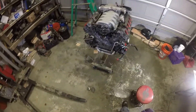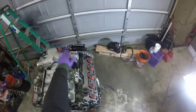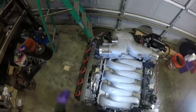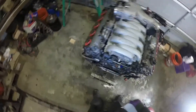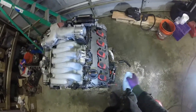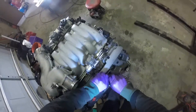I did a bit of degreasing on the engine, some steam cleaning, cleaned it up a little bit. I'm going to go ahead and remove the throttle body, the intake manifold, and the fuel lines that have to come off for that. I want to inspect what's going on with the oil filter housing — I suspect it's leaking. In the meantime, I'll pull off the ignition coil and peer inside to see how much oil we've collected since about 10,000 miles or so. Look at that — covered in oil. There are just so many oil leaks on this, I don't even know where anything originates from anymore.